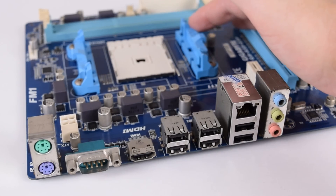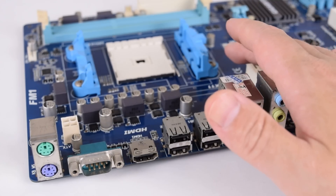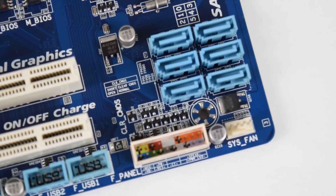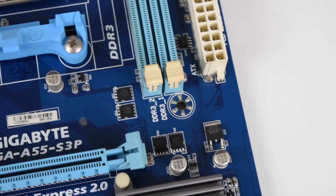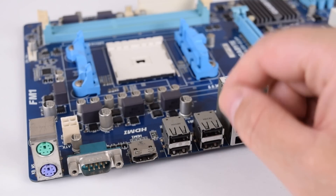A little trick is removing the CPU cooler frames, and underneath I found a lot of dirt and dust, which gave me some insight into the history of this motherboard. It definitely needed cleaning — it was in very filthy conditions — so it went under the shower. For those of you freaking out, it's not an issue; this motherboard had endured years of exposure to dust and dirt. Five minutes of water makes no difference. We have 40-degree weather here in Australia, so over 24 hours the motherboard dried up nicely, and after that the HDMI port started working and half of the USB ports also started working, but not all of them.